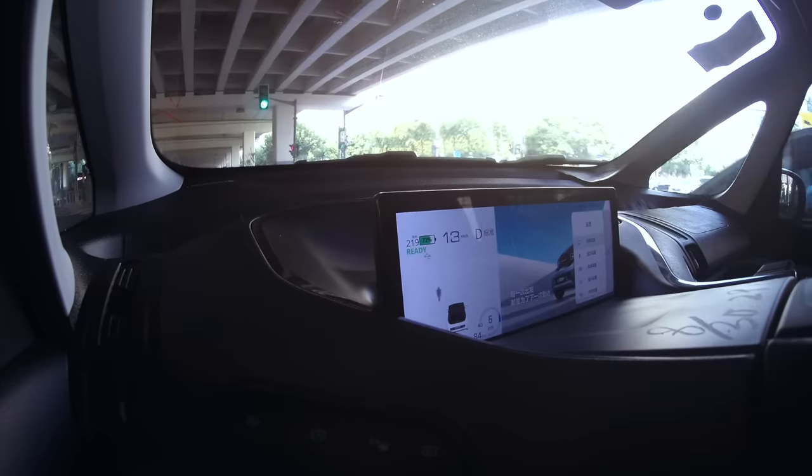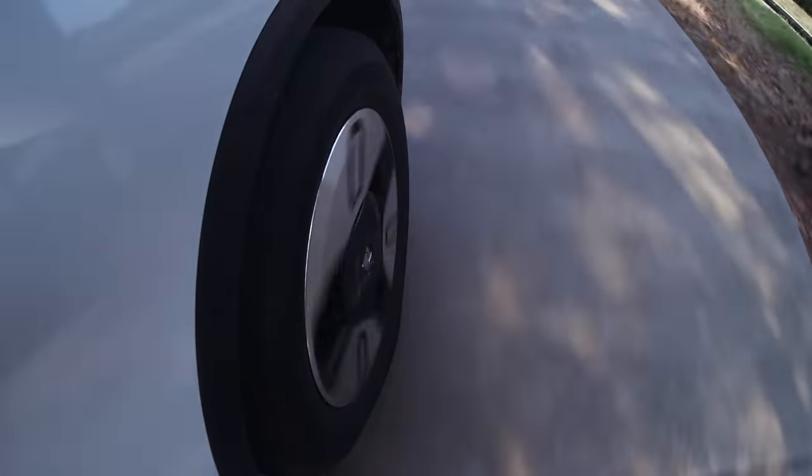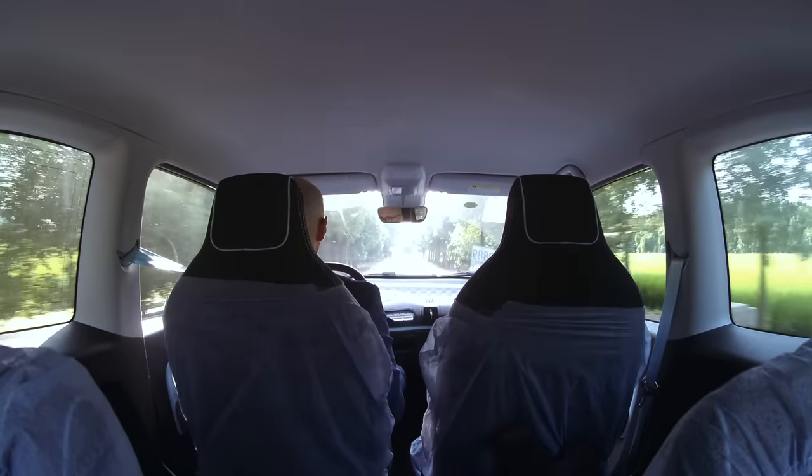For me, the biggest annoyance in this car is the brakes. I feel like I'm treading on a wet sponge when I push them down — I have no confidence at all. I was driving on the highway the other day and had to do some heavier-than-average braking, and it did an emergency stop on the highway, which was not good. It goes soft, soft, soft — no braking — and then all of a sudden it stops and you skid. That's a massive markdown. I imagine it has something to do with the tiny 13-inch wheels, which don't have very big rotors or calipers. Another thing showing this is a cheaper car is the noise — you can really hear the electric motor as it accelerates, whereas most electric cars I've driven in China have great sound deadening.